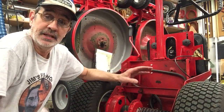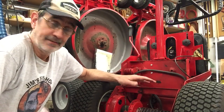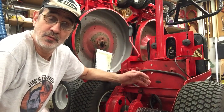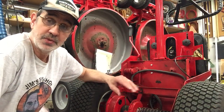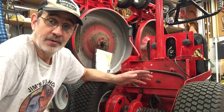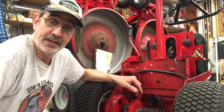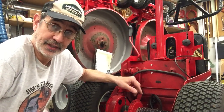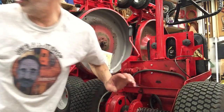It's the first thing I tell somebody: if you're having trouble with your machine moving, tighten the spring. I had one viewer who tore his whole drive train apart thinking there was something wrong inside the chain case or the differential, and there was nothing wrong. It turns out it was the same issue — the spring was in the lowest, weakest setting. So you want to check those springs and check the yoke to make sure it's not worn out.